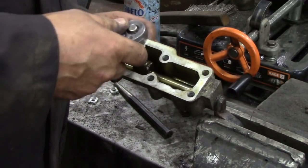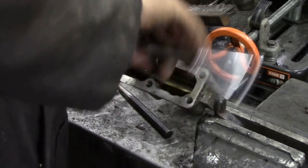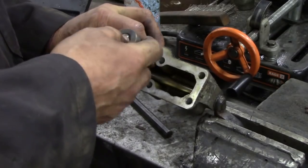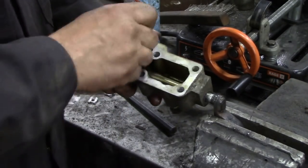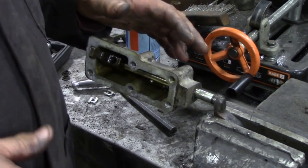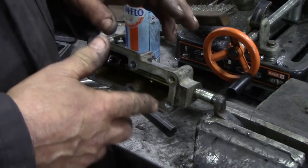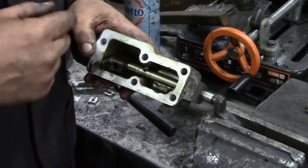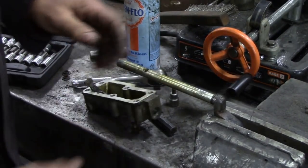Before I put these pins and bushes back in, I thought we'd have a look at this loose lever here. It is quite loose — it's supposed to be located in. That's not good. So this gives us an opportunity to fix another little oil leak often found on Land Rovers. There's an O-ring here, and we're going to pop a new O-ring on there because they feel almost flat. I have known them to splash out and leak down the sides of the gearbox transfer case — making it look like it's an oil seal leaking, but it isn't. So let me pull this off and make note of which way it goes round. The flat bit — the straight flat bit — goes to the back.